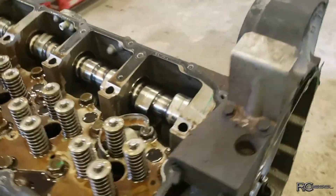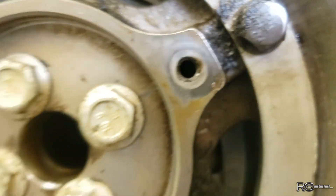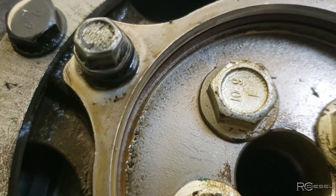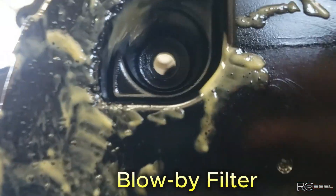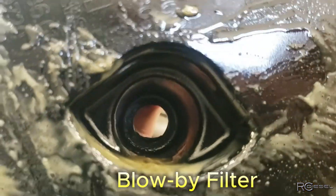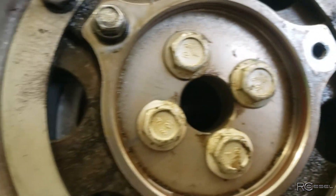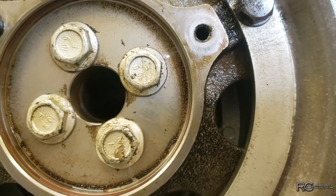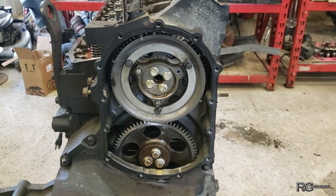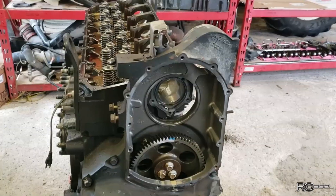We're getting along pretty good here, just about ready to pull the head bolts and pull the head off. Just going to deal with this cam. Notice we're missing a bolt right there — I don't know where it is, it wasn't in the pan. These things have little bushings on them, and I realized this is where that filter thing goes. That hole looks good, but that one's all wallowed out, and that one's all wallowed out too. So this engine was either not assembled correctly, or a bolt was missing or fell out and wrecked the rest. We have to get one of these filter things too. I'm curious if I'll find that bolt in here — I'm going to pull the cam gear off and pull that little housing back in between there, and then I should be able to pull the head bolts and lift the head off.